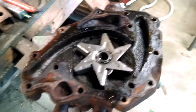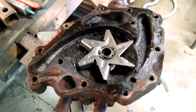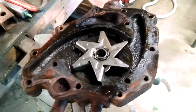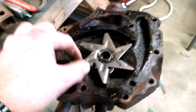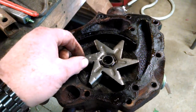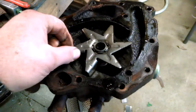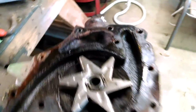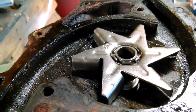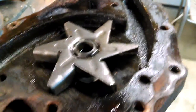I'm not sure how long you'd have to be running mud through these blades to degrade them, but I'd imagine a long time — these are probably stainless steel. This car is an '87, it sat for 11 years, it's only got 64,000 miles on it, and this is probably the original pump. The fluids today are good, they've got rust inhibitors. As long as the blade still looks good, the pump isn't leaking, and it's not slipping on the shaft — with this design I don't even see how that could be possible — it's not the water pump.